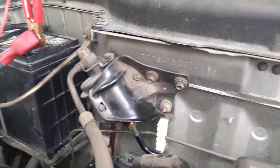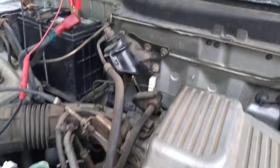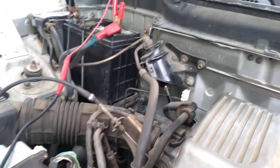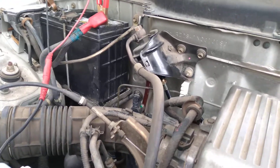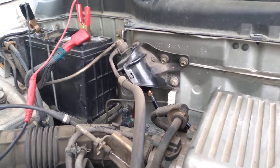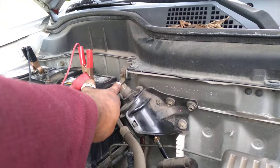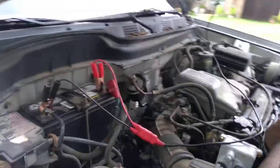We're going to do that through the fuel filter located right in the back of the engine. Look back — boom, it's right there. All we did was loosen this nut. We're going to turn the key to the on position and it should shoot out gas on that end. If it does, sweet — we'll plug it back up. If it doesn't, then we know the fuel pump's going bad. If it does shoot pressure, we're going to do this end and make sure the fuel filter isn't clogged up.